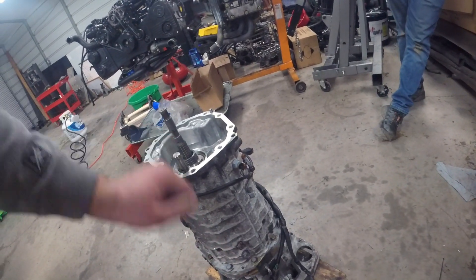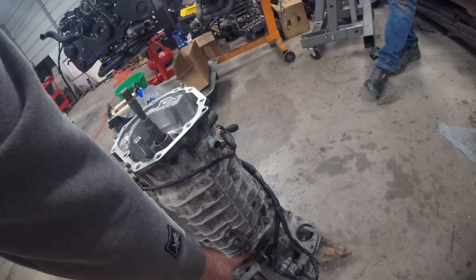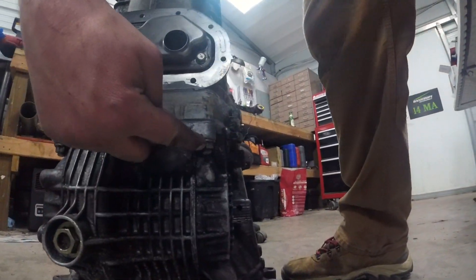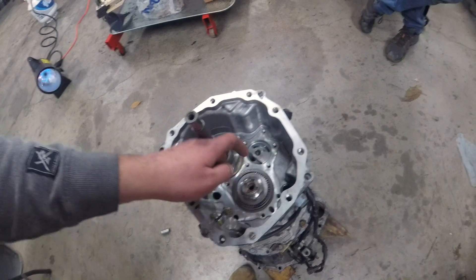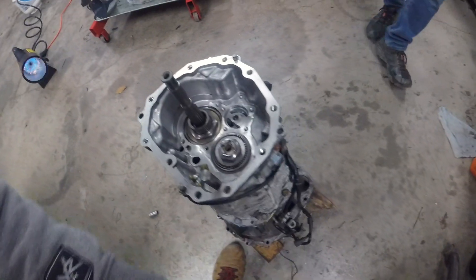And there's push pressure on these shift rods, so don't forget these — make sure they're snug. Tighten all those down. Don't forget that these ones go on the bracket — this bracket right here stays on. And then there are three nuts right here, here, and here that you've got to put on with a wrench. Then we put a block of wood under the input shaft to raise it up a little bit, and put the snap ring underneath that gear. Then you can take it back out.